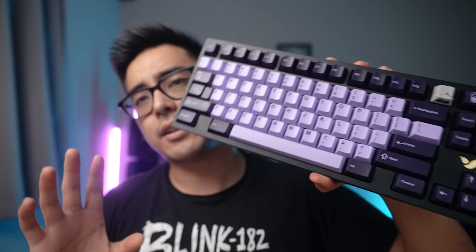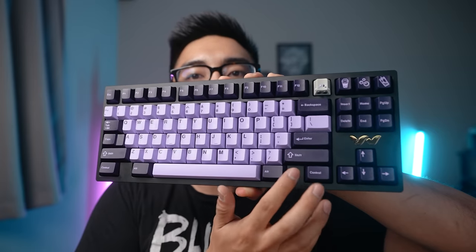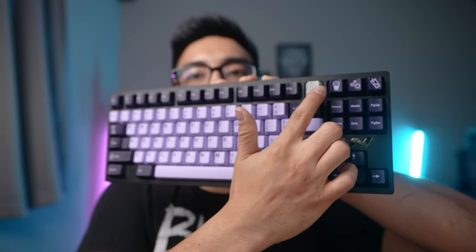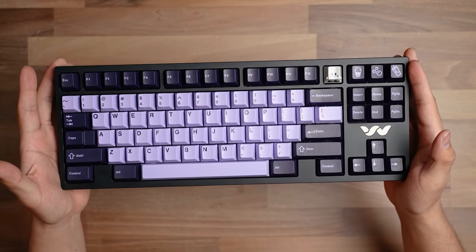Overall, the TKL form factor is pretty standard. It does have winkey-less — you see aluminum here and here. It has F13, which I have in Kiwi there, and those are things a lot of people want in their TKL keyboards. Rather than just having a 6.25U ANSI bottom with four right mods and three left mods, this one looks a little bit fancier. The F13 is usually just for an artisan, but you can map it to a special key using VIA.